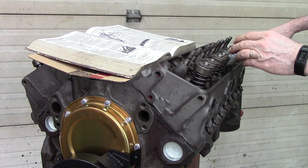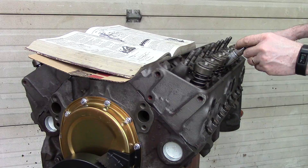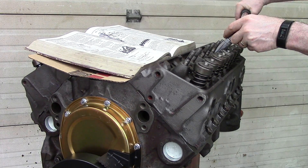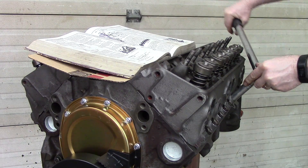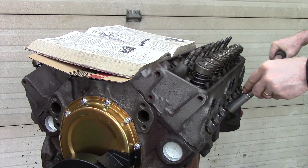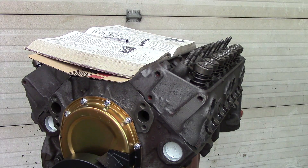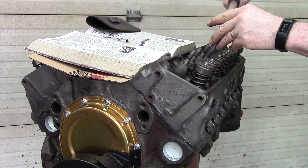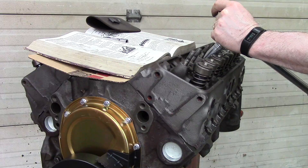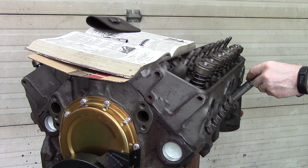So we are ready. I'm going to take it up in approximately 3 increments and then go around a last time. Right now my torque wrench is set for 30 foot-pounds. I screwed up my torque sequence already — I've got to stop looking at the big block diagram on the top. I'm at number 5 right here, and 6 is over here, 7 is down here which I already torqued.